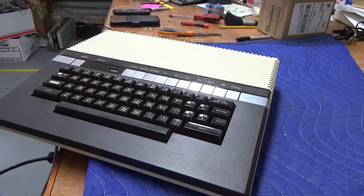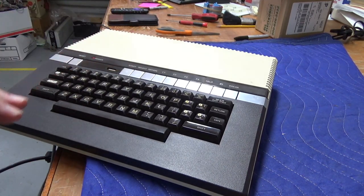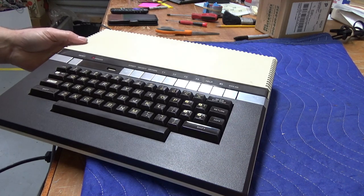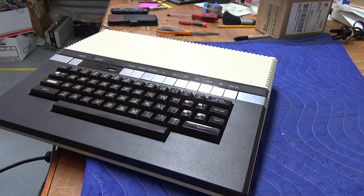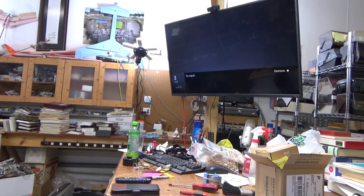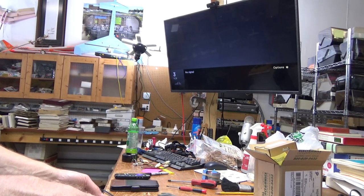Okay, so after a lot of work — I pulled the keyboard apart, carefully peeled the membrane and didn't tear any of it, which is apparently very rare from what I've seen. I cleaned all the pads and cleaned all the carbon, and I've got all but one key working again. I'm going to power it off and go up to the diagnostic mode, where we hold down the Option key and turn on the power.